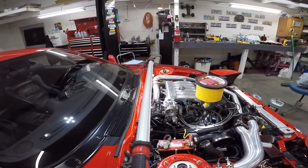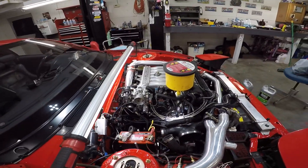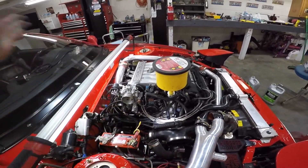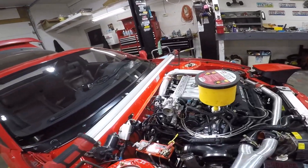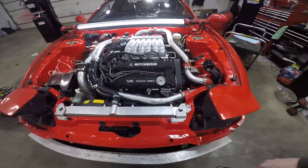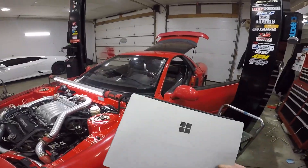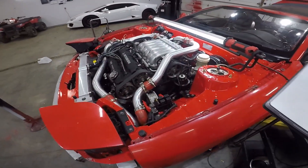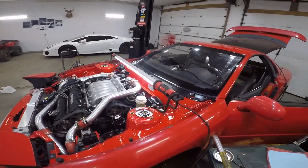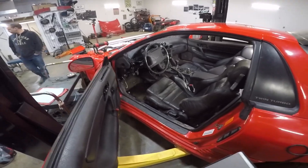Well, if it's not one thing it's another. I had a very small drip on the heater core hose and I thought it was just a little tiny tear — I'll loosen it up and push it up. As soon as I loosened it, it just blew off. Got like half the antifreeze on the ground. Got the antifreeze leak fixed, everything seems good. Got my laptop. Before I start it I need to hook up to the ECU, sync my throttle, and I'm gonna have to sync timing on this thing again — there's no way I got the CAS in the exact right spot. My heart is racing.